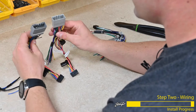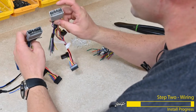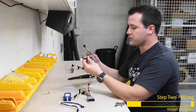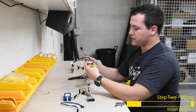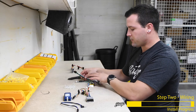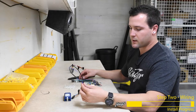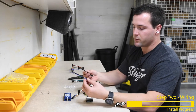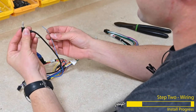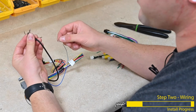You'll only be using one of the two harnesses — use the one that has a more rounded side of the connector. Toss the other one with the squared off connector to the side. When it comes to the radio harnesses, you'll need to grab two of them: one with all the camera inputs, and the other is the main power and speaker wiring harness. We'll be connecting both of these to the radio replacement interface harness. An additional harness that comes with the radio replacement interface is the steering wheel control adapter — it comes with a blue wire and a 3.5mm stereo jack. For the Stinger radio, you'll just cap the blue wire off, and the stereo jack will be plugged into one of the ports on the back of the radio.